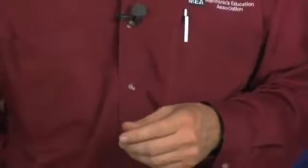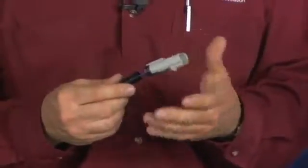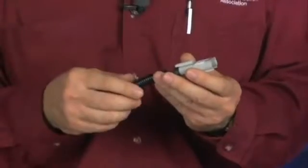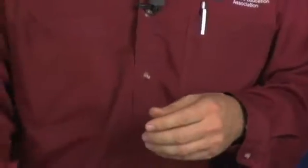Proper voltage to the fuel pump is obviously important to ensure successful repair. If your fuel pump does not have a harness, check to see if a replacement one is available. This will ensure we have good electrical integrity to the fuel pump and a good repair.